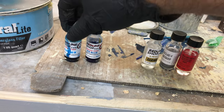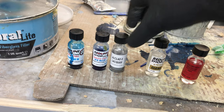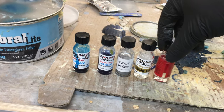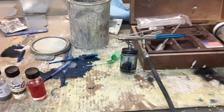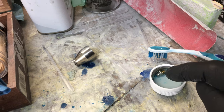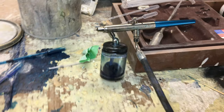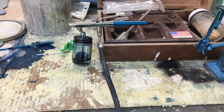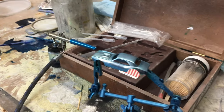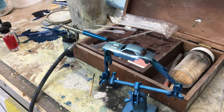Windex gives a little bit of the green shade and the ice blue gives more of the blue, but that was still too dark. So I needed to add a smidge of clear and then five parts of that, plus the hardener. I did 15 parts total because I did a slightly bigger mixture in the cup. A little tip: I have some lacquer thinner — you could use gun wash — to clean the tip, air cap, and needle, because it's got to sit 10 minutes between coats and I was finding it was starting to speckle spray, which means it's drying in there. The second tack coat — that color is looking pretty close and we're going to start putting shiny coats down.